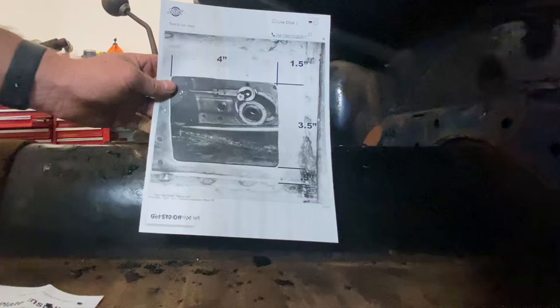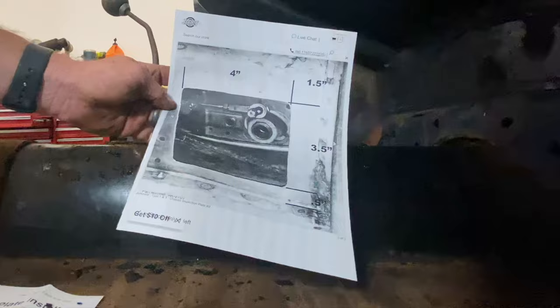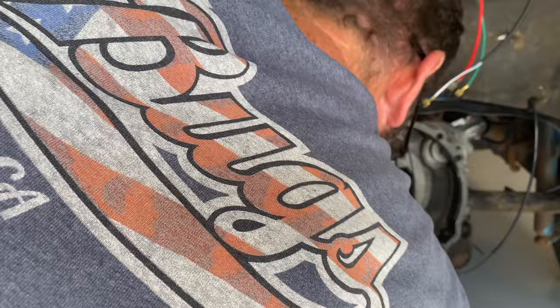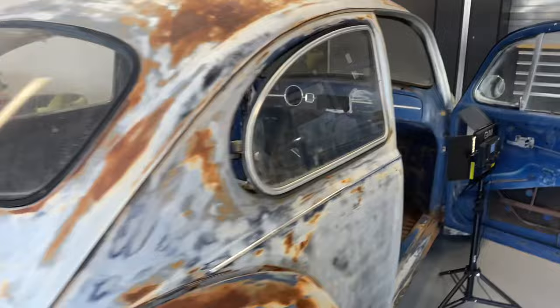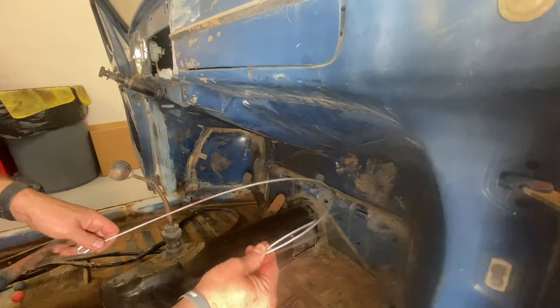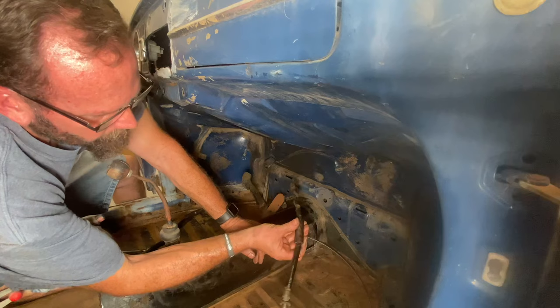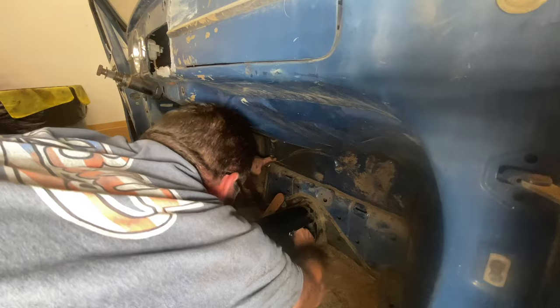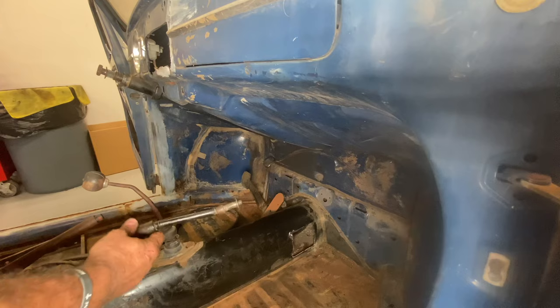I had to change the angle so I could get in here and actually work. We're going to come back an inch and a half from the firewall, come up a half an inch, and cut a hole that's three and a half inches tall and four inches long. This is a perfect time to swap out to a six-shooter. So we've got a lightly greased new German clutch cable. I may have to do some fighting on that Bowden tube in the back. Now that we've got our Bowden sleeve pulled out — honestly, it's seen better days, so I'm going to grab another one. And just like that, our cable's in place.